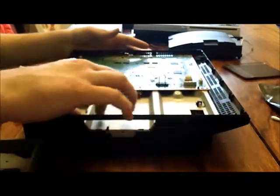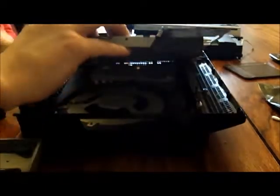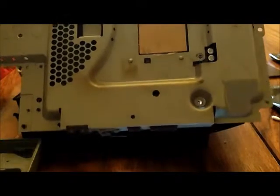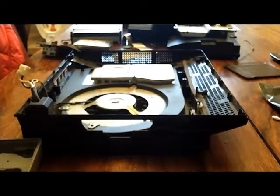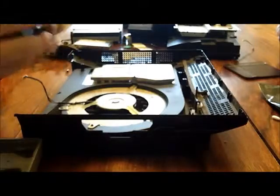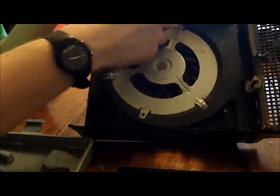With a little bit of force, you can lift up from this side the motherboard and pull back — pull back, pull back — lift up and pull back, and the motherboard will come loose. On the back you can see the heat sinks with the old paste. There's one screw over here in the far corner which removes the power module. And underneath you can see the cooling fan, its power connector, and these heat sinks here.